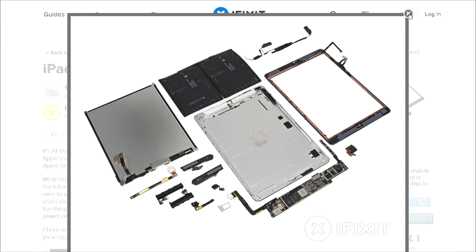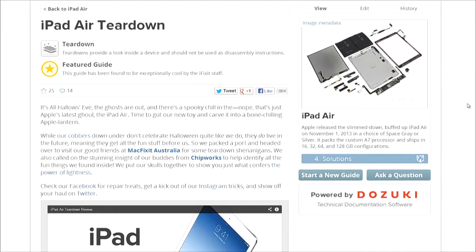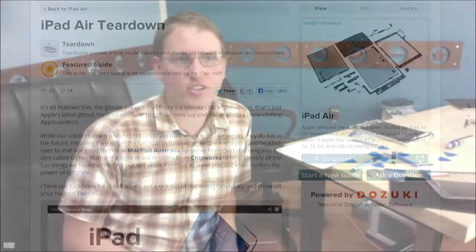Oh, they do. Absolutely, they do. No one else does, but Apple does. Cirrus Logic does a lot of the audio components for Apple, and they're never allowed to put their brand name on the chip. They paint the number out. So the only way to find out is either to find the number in the database or to take the chip apart, grind it layer by layer, and have our friends at Chipworks look at it with an electron microscope. Then they'll stamp Cirrus Logic on the logo inside the chip, but not on the outside. So you have to take it apart.